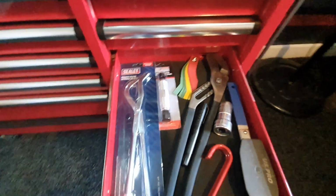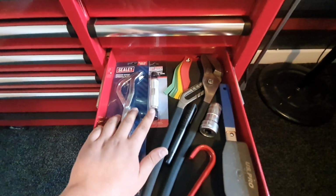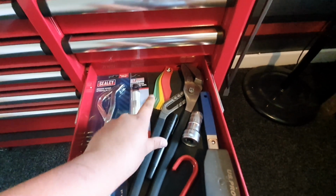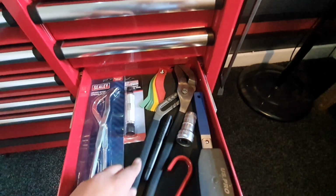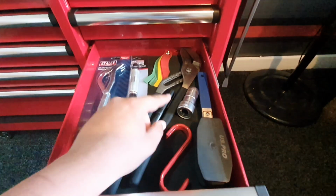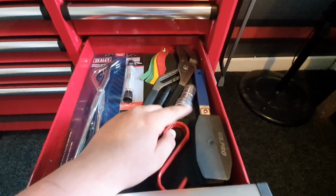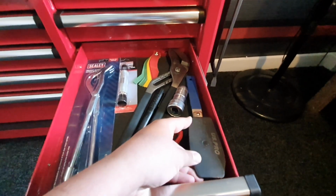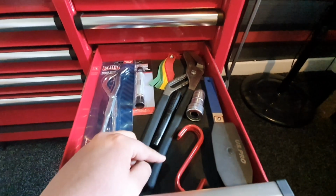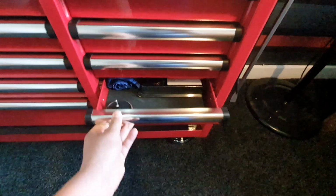and this is the brake drawer. It's got the 2 tools for drum brakes, brake pad thickness gauge, 16-inch water pump pliers for winding back front brake calipers. That's a brake terminal tool to clean it. That's the prop tool to wind front brake calipers back. And 4 S-hooks for brake calipers when you remove them, so they're not dangling on the brake hose.